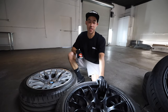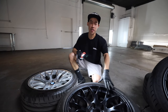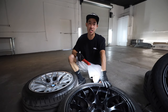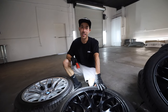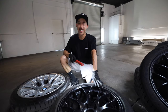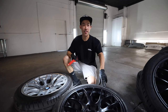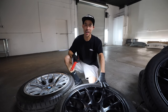Certain all-wheel-drive cars are very sensitive to rolling diameter. When you throw on different wheels, it throws off the rotation that ABS is reading, which can cause a lot of issues. GTRs have a lot of issues with that — you start burning the diffs. Even Lamborghini Murcielagos and Aventadors, which are all-wheel drive, people running staggered setups can really mess up differentials. Even Huracáns — if you throw on a 275-30 on the front and a 275-35 on the rear, you'll fry your differential.